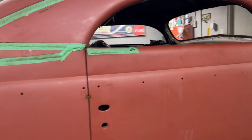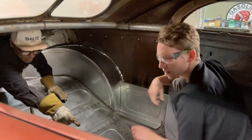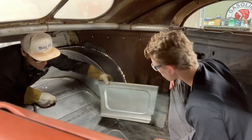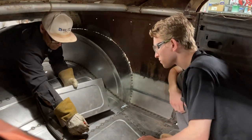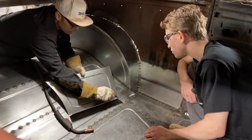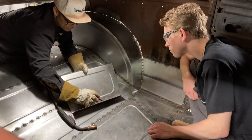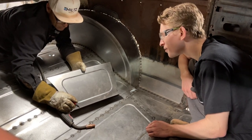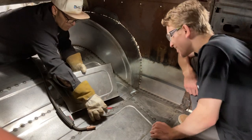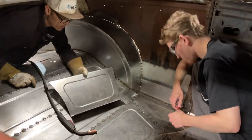Most things are assembled with metal together and a spot weld. To imitate that with a MIG welder, they call it plug welding — you drill a hole and fill the hole full of weld to weld it to that piece. I generally don't do that — I do this instead. I'm going to make a couple of V's in that with the zip cut, just by eye. It's funner to do it by eye — no one tells you what to do.